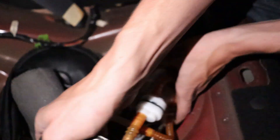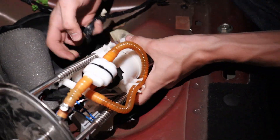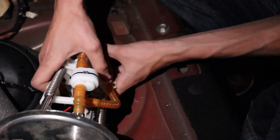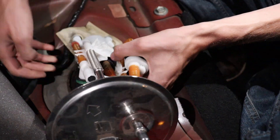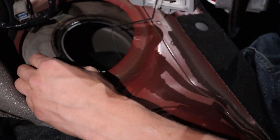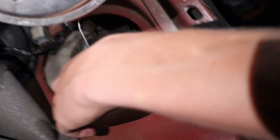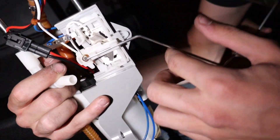Don't bend it or else your gas gauge is going to be off. See how I'm pulling it out at an angle — hopefully because I can't see anything I'm not going to bend that arm as I get fuel all over the place. What am I caught on? Oh, there's a line — of course there's a line. Goodbye. See that arm right there? That's what's broken.